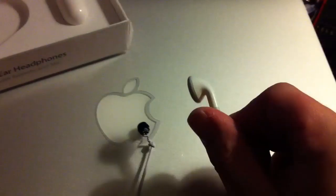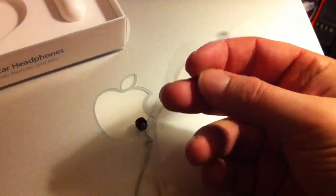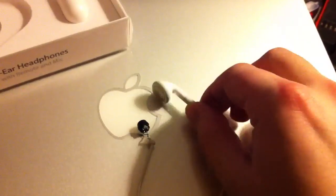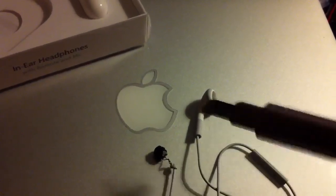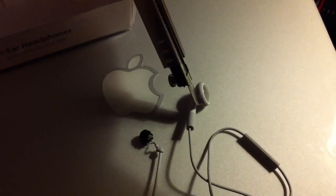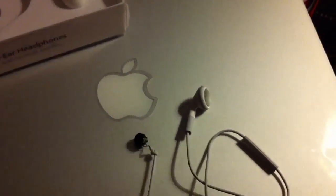And it's to crack these open without snapping the wire, because if you snap the wire, trust me, you'll not be able to solder the wire back together. It's so thin, so you've got to be careful with this step. So on this step, difficult to do it with one hand, but you take a knife, and obviously you hold it better than I'm doing, and you insert the knife in the groove between the rubber and the plastic, and you push down and it'll basically crack. I'll show you.